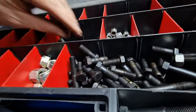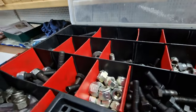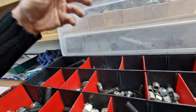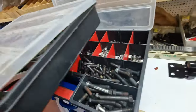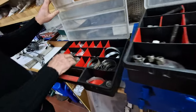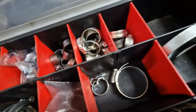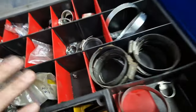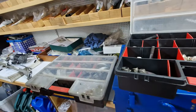All the original bolts and nuts are ready. We also have the clamps — a whole bunch — all counted and dedicated to the cars. These squared washers and spring washers are important: Jaguar always used squared washers where the width equals the height, and very often you find rectangular ones instead where the width is longer than the height. Make sure you use the correct squared profile as Jaguar specified.